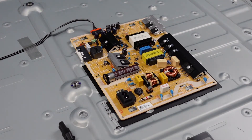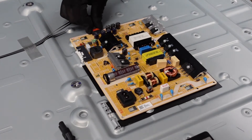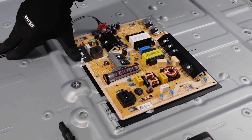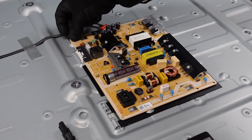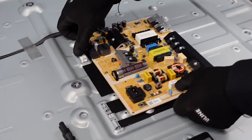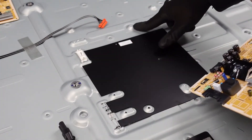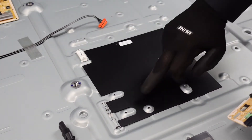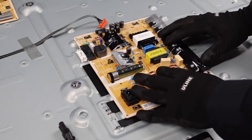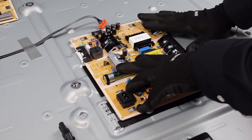Looks like another screwless situation. We're just going to pinch these two sides on this clip and scoot that on out. And then on this one, we're just going to pinch down to release that latch and lift up at the same time to get this nub out of the way — pinch it, lift up that nub, and kind of scoot the board out. We've got the power supply removed and now we've got our replacement power supply. Just check for your holes — that's where everything's going to slide into — and don't forget about your clip. Line everything up, make sure it's all flat, and when you scoot it inside, everything should just fall right into place.